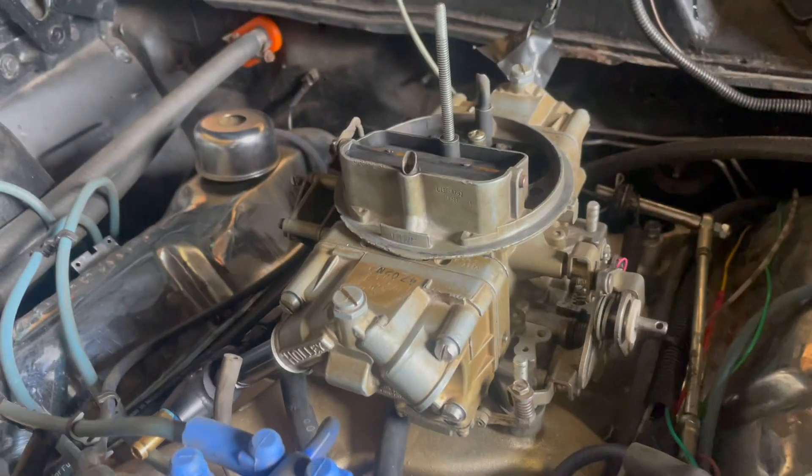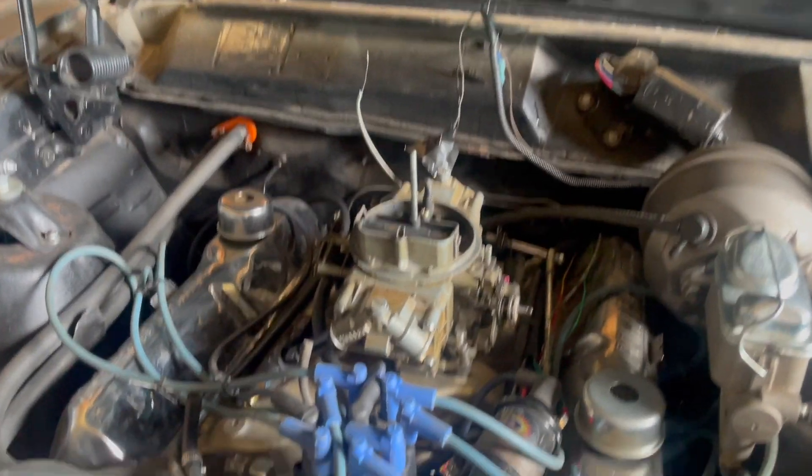I've got the carb all put back together and everything installed on it. The carburetor tuning changes I made — the power valve lock-off plate in the secondaries and the smaller power valve on the primaries — made a huge difference. Rather than the AFR being at like 10.9 under full throttle, it's like 12.2 or something, which is a lot better. I'd like to be a little leaner still — maybe drop a couple of jet sizes — but it's much, much better. It sounds noticeably better under full throttle. I really hope you guys enjoyed, and we'll see you next time on It'll Run.